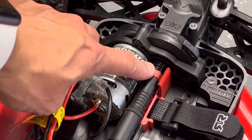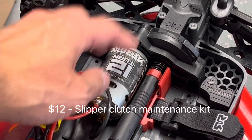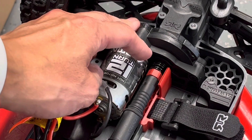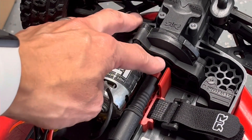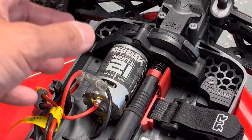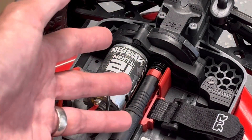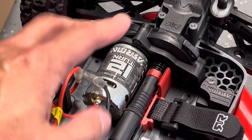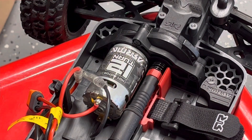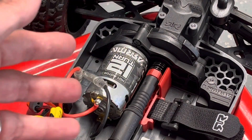The slipper clutch assembly is also very different from the 3S BLX. So if you're going to change to brushless, my recommendation is to change the entire power module — including the red bracket version and the 3S BLX slipper clutch. To summarize: you're not going to be able to just swap the motor and ESC and call this a 3S BLX — that's not how it works. If you are going to upgrade, that's an option, but for the best savings and value, you're going to want to buy the 3S BLX out of the box.